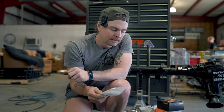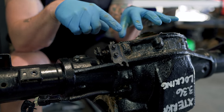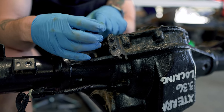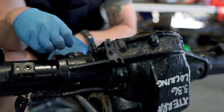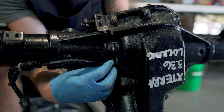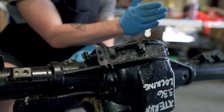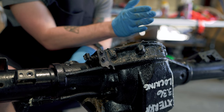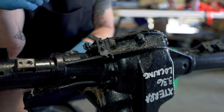Before we're able to pull the carrier, we actually have to disconnect the wiring harness that runs to the electromagnet. There's an 8mm bolt right here that I've already loosened — that's going to come out. This is held in with an o-ring that's been sitting for many years, so it's going to be a little bit of a pain to wiggle out. Once that comes out there will be a clip we'll remove, and then the carrier will be ready to come out. At the back there is essentially a plunger that's also a sensor. When the locker is on, it pulls that plunger toward the driver's side and sends a signal to the PCM that the locker is engaged. Our Xterra is not a Pro 4X, so we'll just remove this and plug it with a pipe plug — we're just going to have a manual toggle switch wired in with a relay.